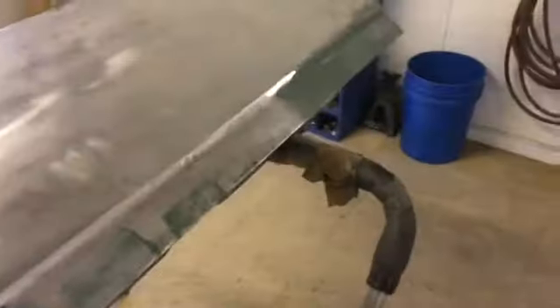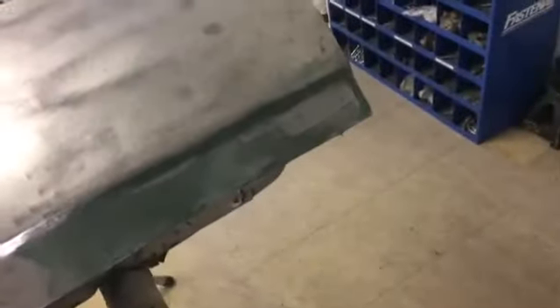Hey YouTube, Jeff in the garage. Friday afternoon about 7:30 on the 8th — a couple days before the hurricane is supposed to get to us. Hopefully that thing goes a different way. We came out in the shop today, got the door in 80 grit, cleaned it up, wiped it down good, and mixed up some Dura-glass — short-strand fiberglass. We just had a few little places we made a swipe across. Took care of two or three little places, nothing major on the door skin. That's where we're at with the driver's side door — a lot of work, a lot of boring work on car doors.